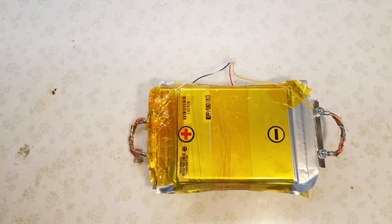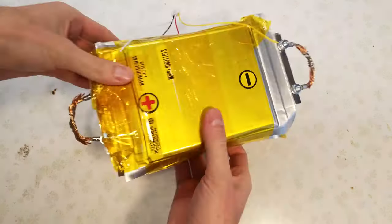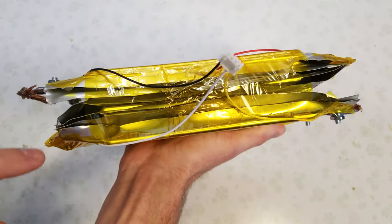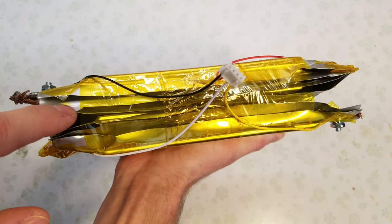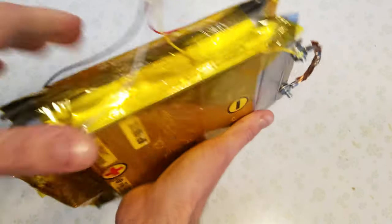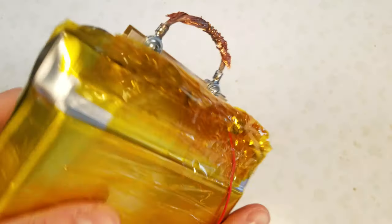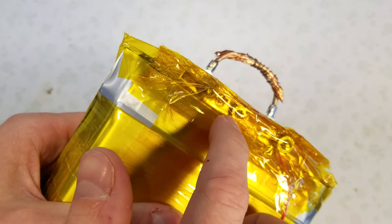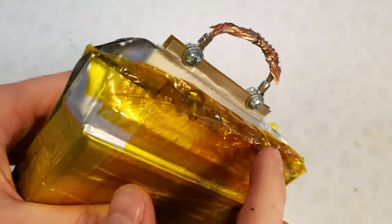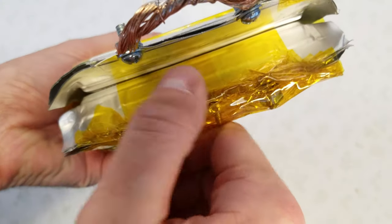It's actually been about three or four weeks since I filmed the first part of this video, and it's time to get back at it. Here's the completed battery pack with the six cells I tested. They're connected two in parallel, and those parallel sets are wired in series, giving us a rough 12 volt battery pack. To make the connections I used standard steel screws from the hardware store. In between cell packs I drilled a third hole and have three screws. Everything is covered with Kapton tape — three or four layers on each end of the connections to make sure it's extra insulated.